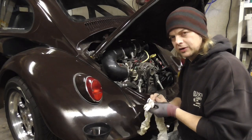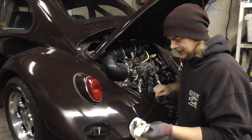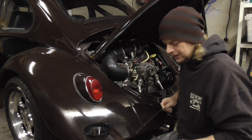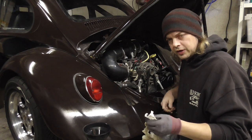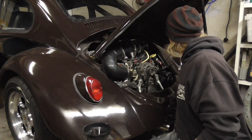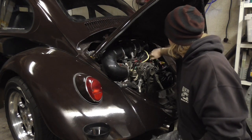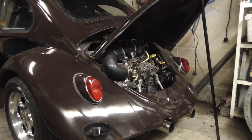I'm a bit confused because I've only put about four litres in and it's showing as full on the dipstick. I think I might have remembered it wrong and it's actually a four-litre something rather than four and a half. So we're just going to start the engine, make sure the oil galleries and everything are full of oil, check the levels, and we should be good to go.